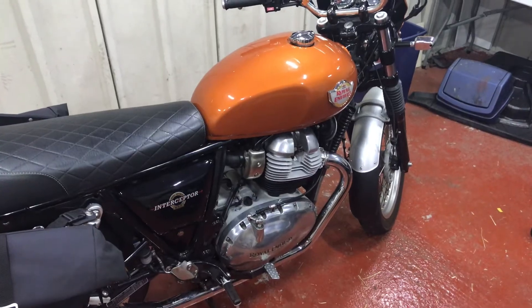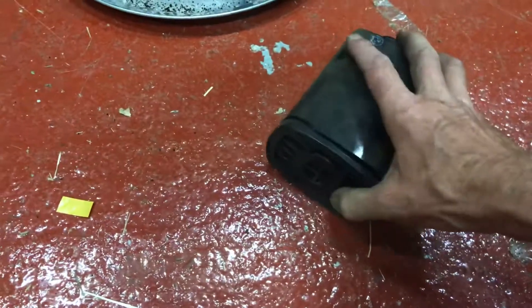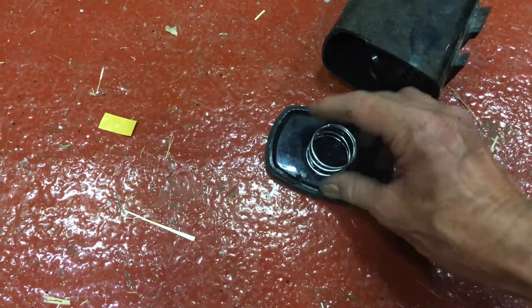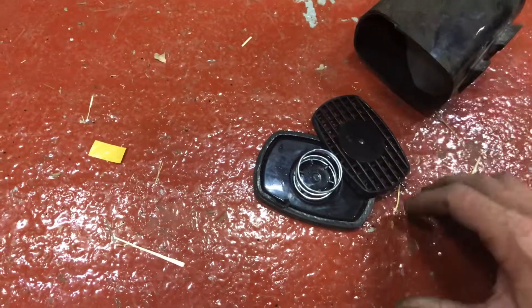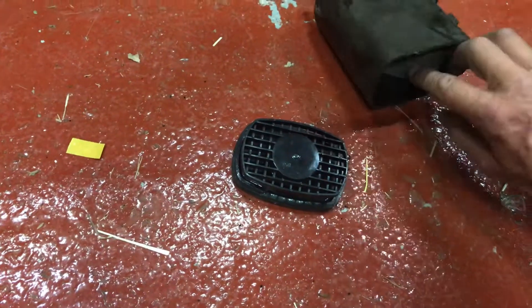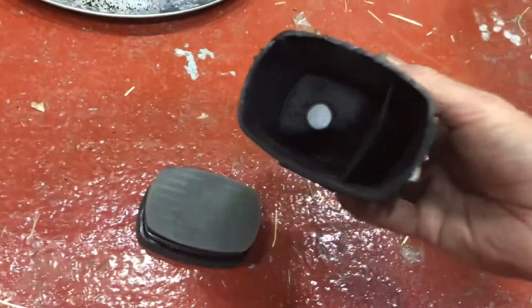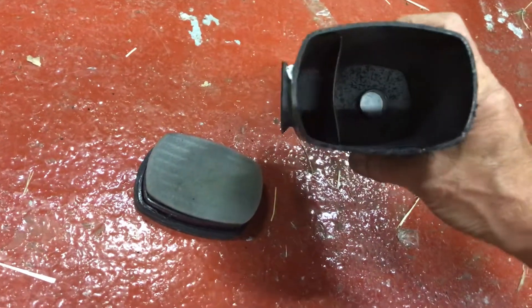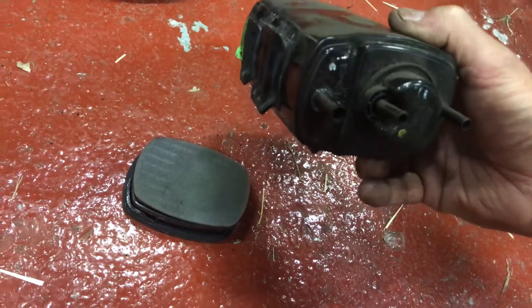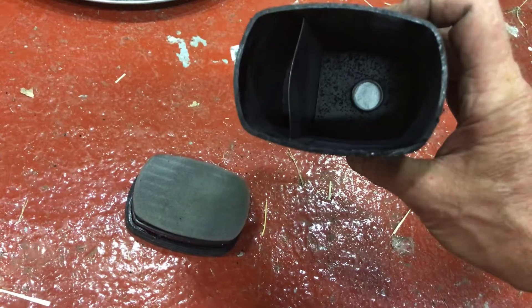Because when I did the autopsy — here it is. So that's the cartridge. I've sawed it off with a hand saw. If you take the lid off, you've got a spring and a recess to put the spring on. You've then got this grill, again with a recess for the spring. Then you've also got this foam pad which sits on there, and the whole lot goes in. The left-hand chamber is for the breather, which comes out of that pipe there — the breather pipe that goes up behind the battery. It doesn't really do anything, it's just a breather. And that's obviously the one from the tank, with a little felt pad down there.